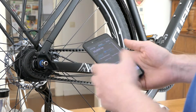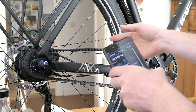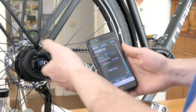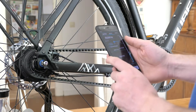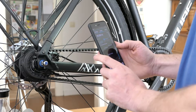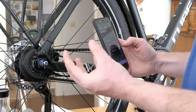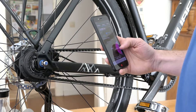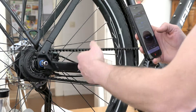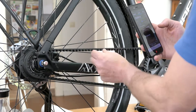I measured with my Fast Fourier Transform app that the sound frequency is near 60 Hz. So I start with 35 Hz on the strobe app and I can test it now. I adjust the frame rate and now you can see the strobe light effects. My idea is that when I have the same frame rate, double, or half the frame rate as the belt vibration frequency, I will get a steady image of the belt.